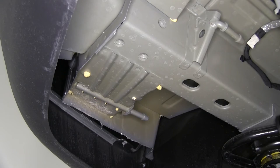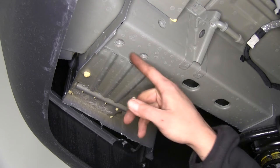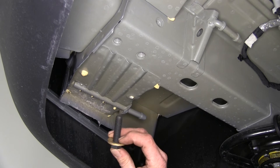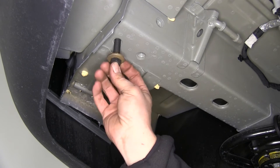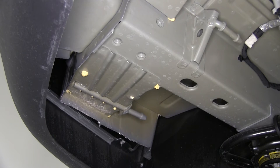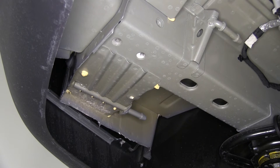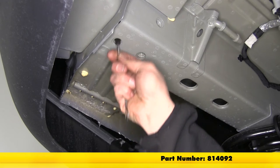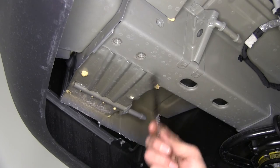Let's take a look at our attachment location. On the driver side at the rear frame rail, we've got two existing weld nuts where we'll put one of our M12 (12mm) fasteners, each with a conical tooth washer — teeth facing in towards our hitch. It's a good idea to hit any weld nut with a little lubricant, then clean it out with a tube brush to remove any dirt, debris, or rust from the threads.